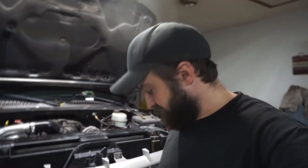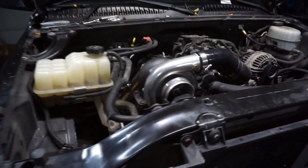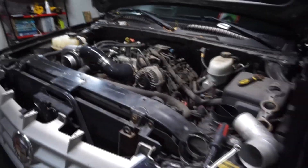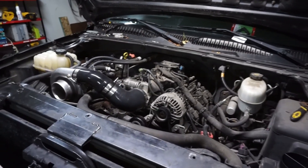I don't think a one-to-one fuel pressure regulator is really going to matter running around nine pounds of boost. The goal is to keep it as cheap and easy as possible and show what you can do if you just want to hammer through it and get a turbo running. A lot of this applies to pretty much any GM truck since they all look the same — so if you want to throw a turbo on something without doing a full LS swap, this is how you do it.